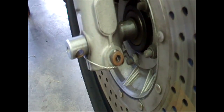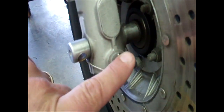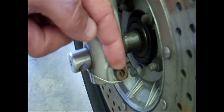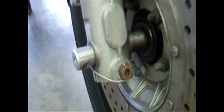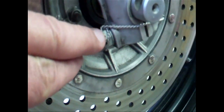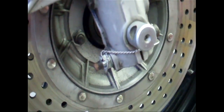In order to safety wire the front axle pinch bolts we need to get more parent material, so we substituted Allen heads for the stock bolts and drilled through. These are grade 10, and on the other side I used castle nuts rather than drilling through the regular nuts, to make sure that I had an ability to safety wire that in place.